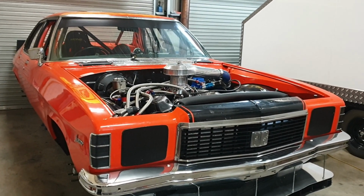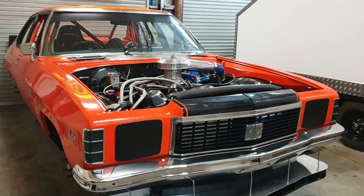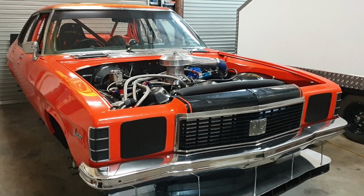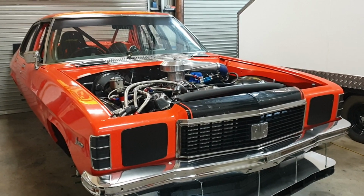Just prove that. I mean, I will torque it back down again once I pull the headers out and redo, I'm going to do my O2 bungs. I'm still keen to do that, and I want to sort of get an overall reading on all my cylinders and make sure the distribution is where it's at. Even now on number 3, that's the one I read from. So it's very, very close actually with the 2 jet change.